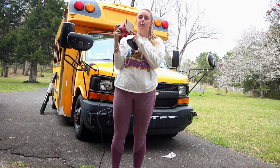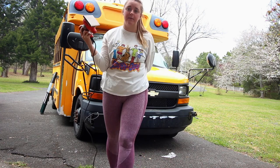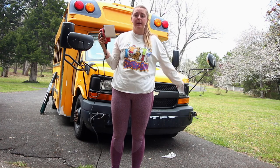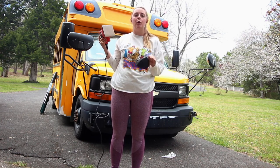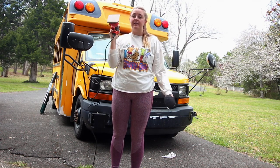Pretty much all of the glue has come off of the outside of the bus. There is still some residue, but I have gone through a whole bottle of Goo Gone and I'm over it. So we are moving on to sanding the bus, which is the last preparation step for painting. I've got my electric sander with some 100 grit on here. I've got a face mask because there is a lot of paint residue coming off. I'm using the electric sander for big chunks of space, big panels, and then coming in with a little hand sander or sandpaper to get to the details and curves it can't reach.